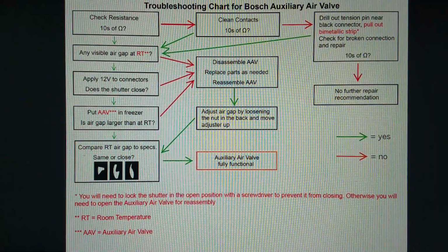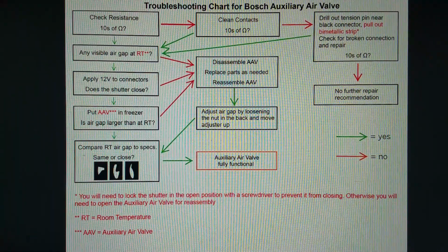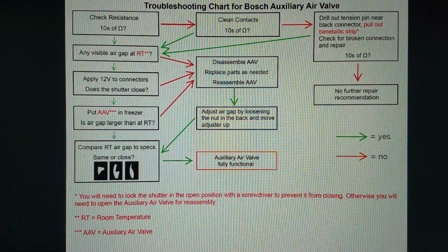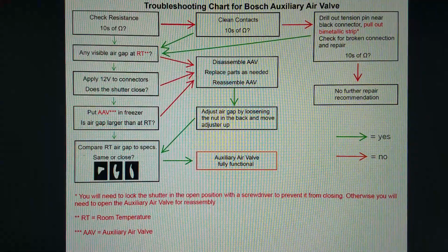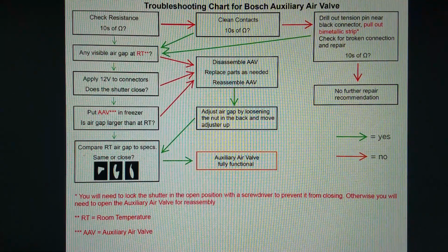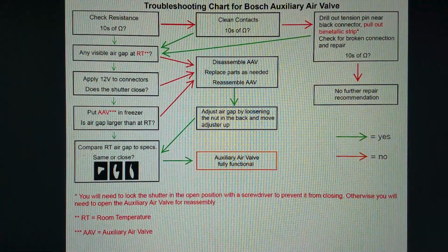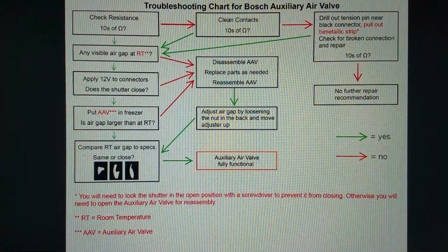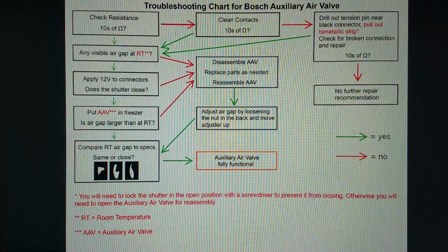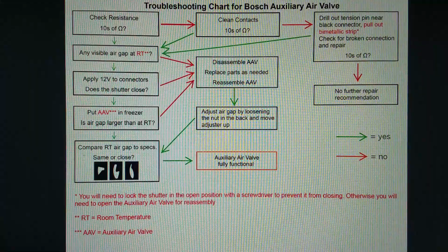And then once you have disassembled it and replaced the part that needed replacing, the next step is to once again adjust the air gap. And if you see air gaps like in the lower left corner, then you're fine again, and then your auxiliary air valve should work. So I hope this helps, and if I find anything that's wrong there, I'll add to that troubleshooting chart, but for now I'm going to put that in the description of the video as a link, and that should be it.